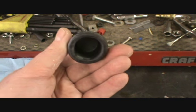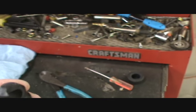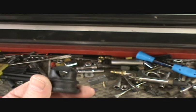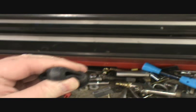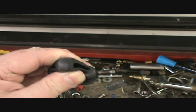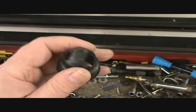That'll help you guys keep from having so much oil blow up into your push-in breather. Here's what you're looking at — you can see I cut two slots in it, one on each side. Just squeeze it together and cut it with a pair of side cutters, dykes, or whatever you've got. If you have to, you can use a razor blade, but just try to leave a piece in the middle so it acts as a baffle.